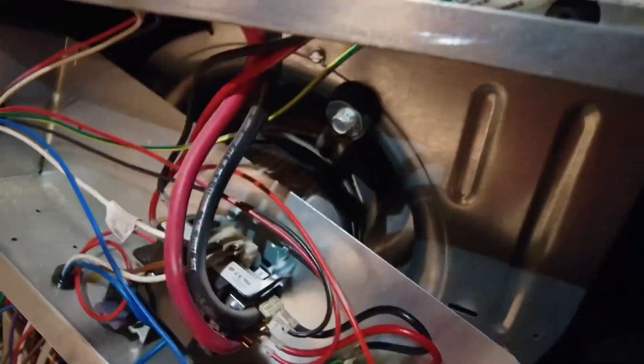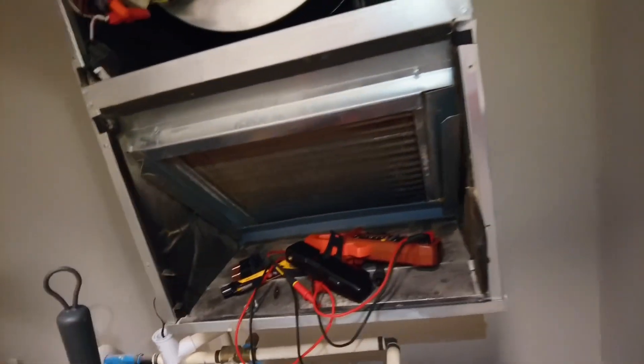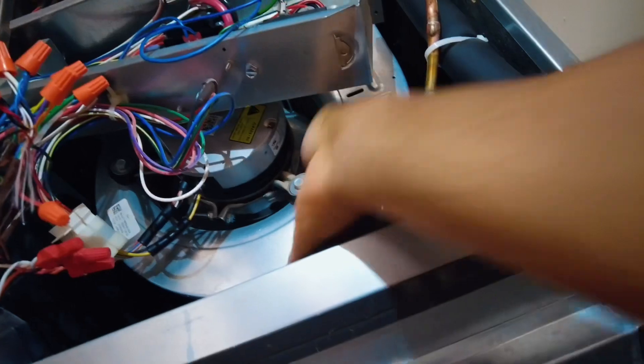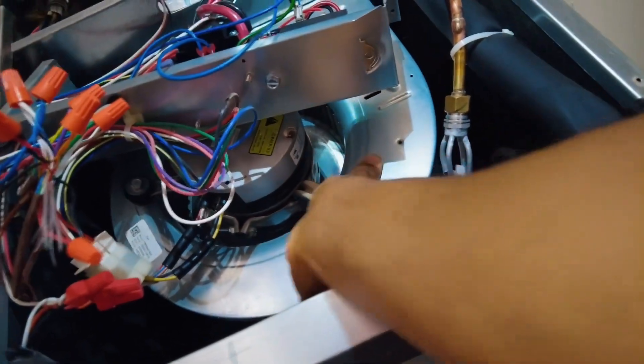Okay, this is the kind of tricky part here. You can see we've got three screw holes here. The trick with this is, on this last screw, you've got to time it perfectly because you've got to catch it. So as I'm unscrewing this, I've got to catch this motor before it falls. I'm holding the motor and unscrewing this — the motor's going to drop out, and you don't want it to drop and fall on the slab coil and blow it out.